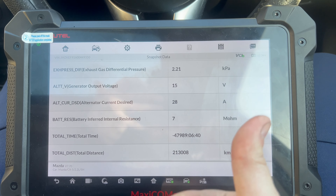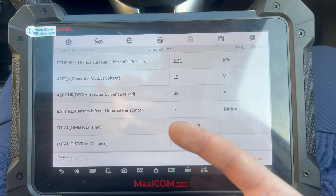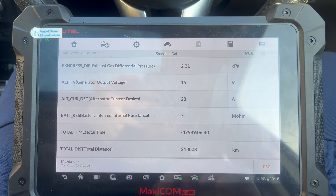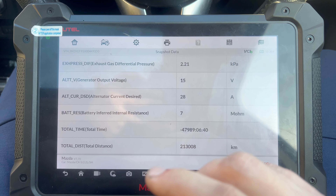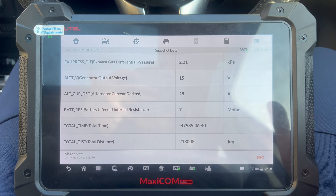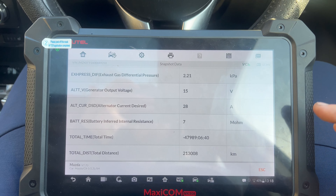So to summarise, I'll do four things: first the compression test, second I'll get a gauge to mechanically test the oil pressure switch and compare readings with the scan tool, third remove the oil pan and check the bottom end and oil strainer condition, and fourth change the oil control valve itself. I'll report back on whether each step solves the issue. Next up is the compression test.